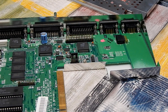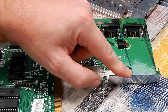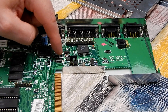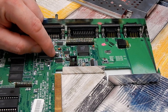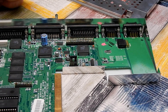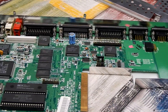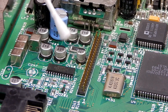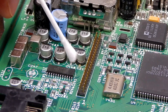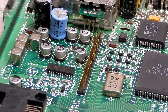Now that I'm in, it's pretty obvious someone has been in before — one metal tab that should be here is missing, and another just fell off as I touched it. Looking at the capacitors, I'm not sure if they're original or not. One of them has a solder point that looks like it may have been redone. But going down to the other end of the board, the solder point on one capacitor definitely looks dodgy — it looks corroded. That's the only one; everything else looks good.